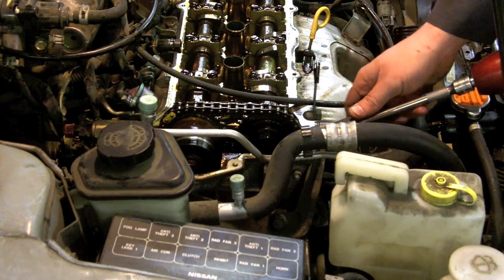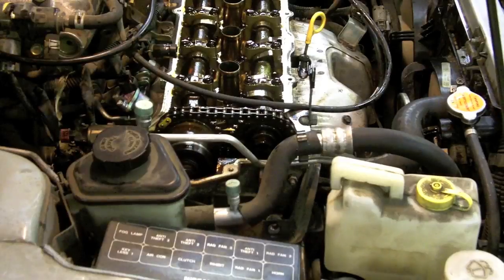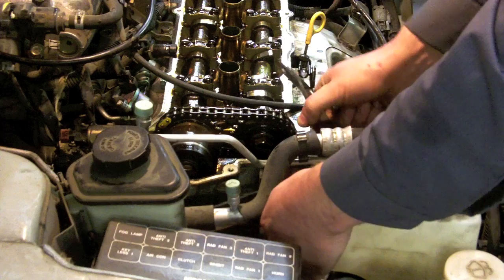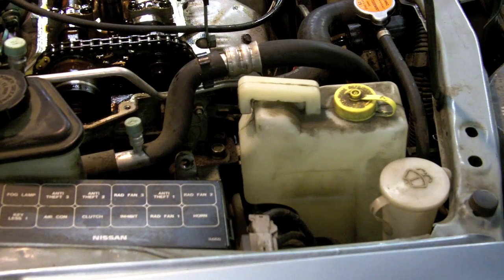Alright, I'm going to go ahead and start by removing the cylinder head mounting bracket. That bracket is held on by 3 bolts with a 14mm head. Before removing the motor mount, I supported the bottom of the engine with a floor jack. One of the things you want to do is use a piece of wood on top of your floor jack to avoid denting your oil pan.